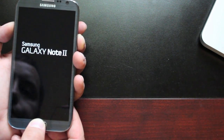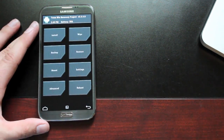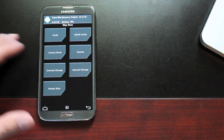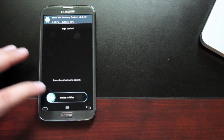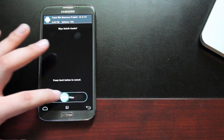Okay, so we'll go ahead and power into recovery. Hold volume up, home button, and power. From here it's going to be pretty easy — you'll be able to install this over any ROM or any firmware. Just make sure you do your wipes: wipe, factory reset, swipe to wipe. Then go back, cache, swipe to wipe. Dalvik cache, swipe to wipe.